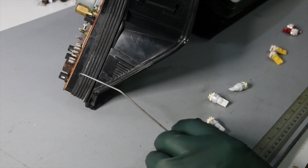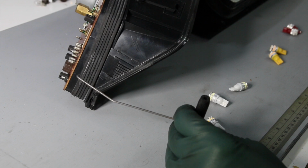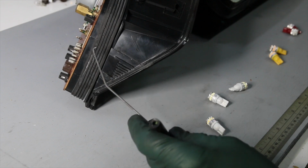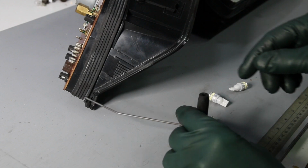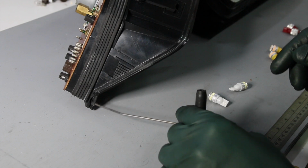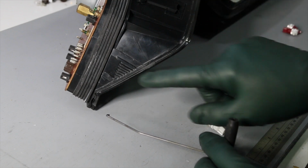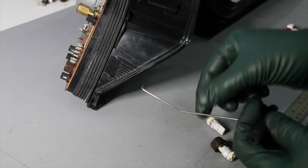These special tools come in a pair, and I have designed and I make these here in my shop with some very heavy spring steel, because sometimes you really have to pull to get these cluster housings out of the dash. A lot of people will try to get this dash tool in here and hook in here somewhere, and they'll end up breaking this face off the cluster housing. See these lines right there? That's where you want to engage the tool.